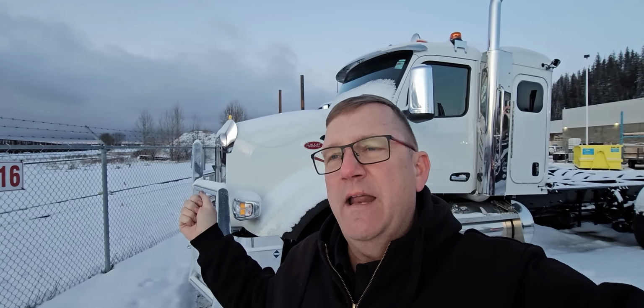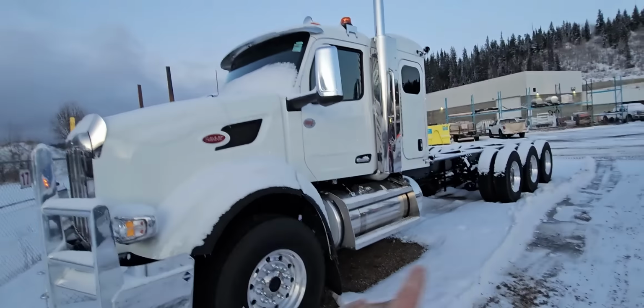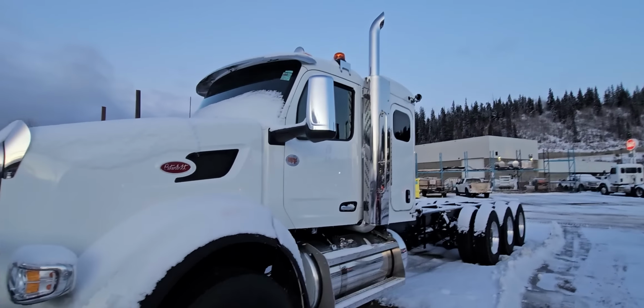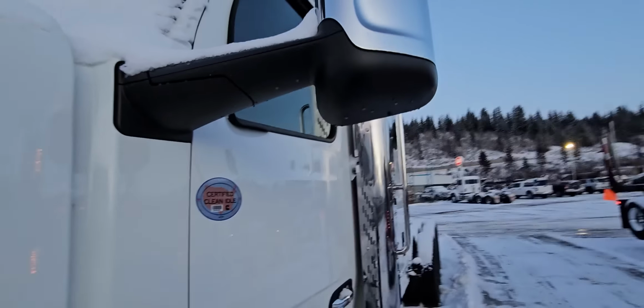It's so bodybuilders and rig out shops know how high the cab is, where the frame is, what the RBMs of the frames are. It's great information, and it's really fun to learn some knowledge. So if you look up the bodybuilder manual, it'll tell you how wide those mirrors are. And we're actually developing a wide load mirror option for these as well, for 9.6 or predominantly 10.6, because they work not bad for 9.6 bunks, but 10.6, places like Alberta, or if you're off highway and you're 10.6 wide, yeah, then you can't see anything out your mirror.